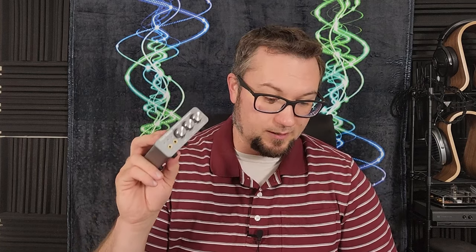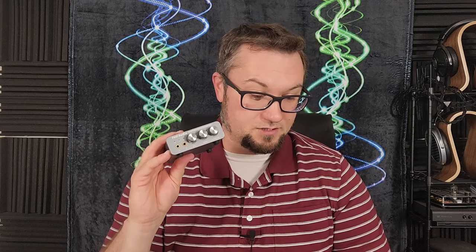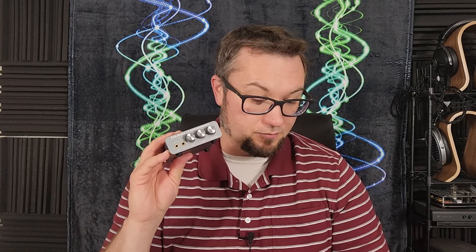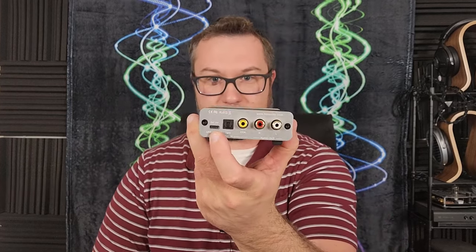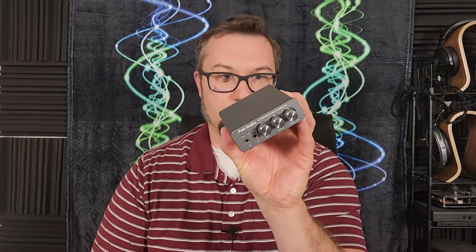The USB implementation is basic — the USB controller accepts PCM signals up to 24-bit/96kHz. The S/PDIF inputs handle up to 24-bit/192kHz. There's no DSD decoding, no MQA — just basic PCM decoding. The headphone output is specced at 500mW at a 30-ohm load and 80mW at a 300-ohm load. That's not fantastic power, but for a USB-powered device at this price it's reasonable. You do need USB plugged in for power even when using S/PDIF inputs.